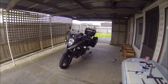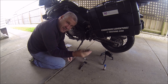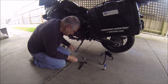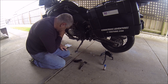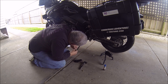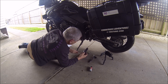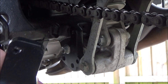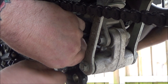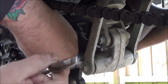We're down at the bike. This is the first bracket that goes on - right there, it goes in down here. We've got all the stuff we need right here. We've got to put the bottom bolt in first, put a bit of thread locker on there, and pop that through. We've got to put a spacer on this one. That one started up okay, and we'll just tighten it up - won't tighten it up all the way.